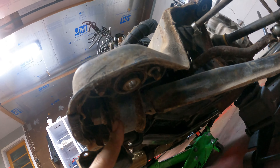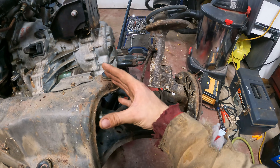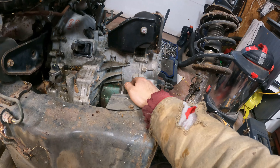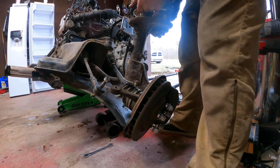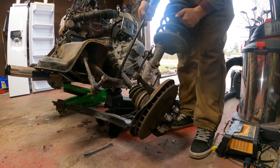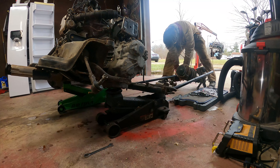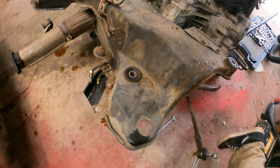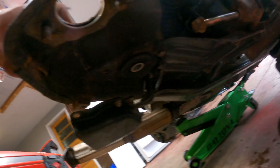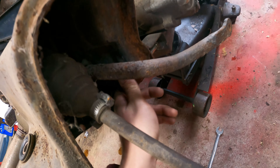The main goal now is getting this bracket off the subframe, potentially pulling off the whole A-arm, disconnecting the tie rod, and hopefully pulling the whole axle out in one assembly to keep it simple. We'll put our remaining hardware back since we're still learning, and then start working on the opposing side.